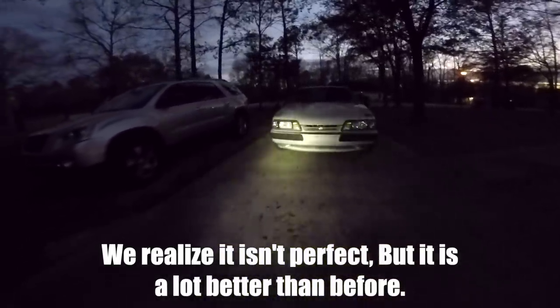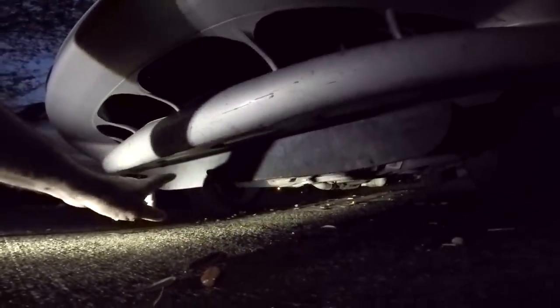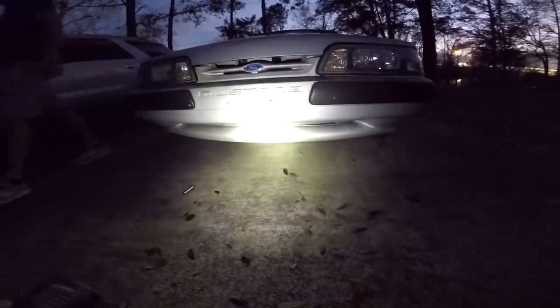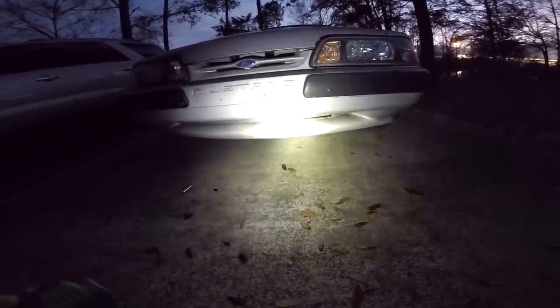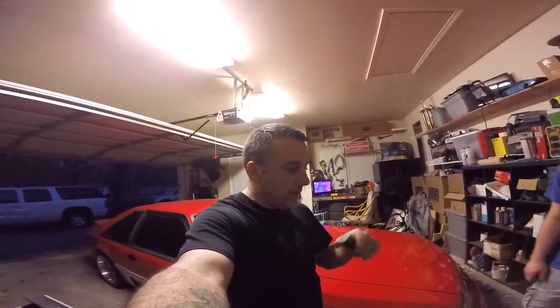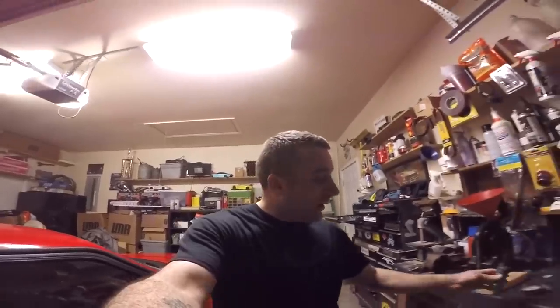It's got the perfect little crown in the bottom of it — everything looks pretty good. What we did was we took the bottom apart down here, took the screws out so that the bottom of the bumper would lay down. We cut a board to put inside of it to kind of force it to straighten itself out. We're going to leave it in for a little while, probably put some heat on it a few times, and eventually hopefully take the board out — that's four hundred dollars he doesn't have to spend now. It's essentially just a brace in there to straighten out that bumper, and we're going to force it to conform to that shape. That's what you've got to do sometimes in the fox body world unless you just have unlimited money to blow.